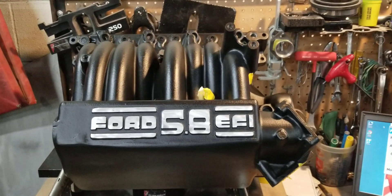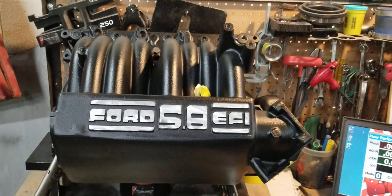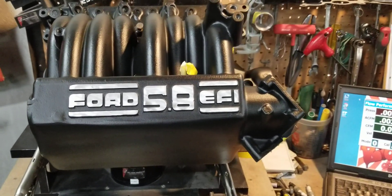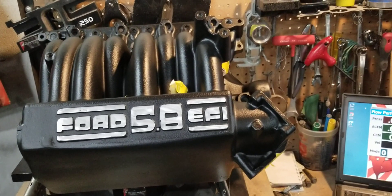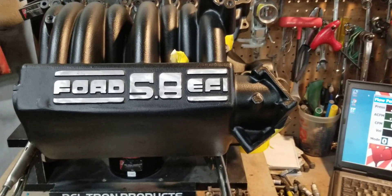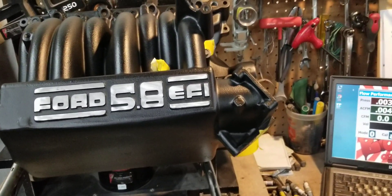That's more than a Trick Flow R manifold as far as flow wise, and you know what those can do out of the box. Now, this manifold still has the long runner — it was shortened on the inside about an inch to an inch and a quarter. For every inch you shorten on a manifold, that's about 250 to 275 more RPM in the RPM band. But with a nice cam, you have enough CFM flow to support a lot of horsepower. This thing can support a lot of horsepower. And this is actually the number 3 runner right here, which has the sharper curve — so that's pretty good.